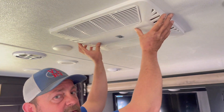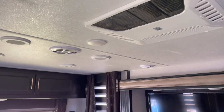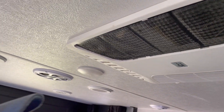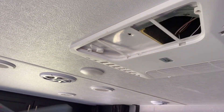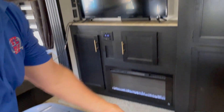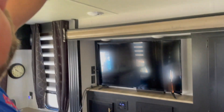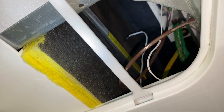If you've got a camper or motor home with ceiling assemblies where you can access the air conditioner, you're going to want to pull the grate off — on these Colemans, I take a little pocket knife so I can get at the end of the filter, slide it out, and check it. If the filter's clean, great. If not, clean it up and let it get good and dry before you put it back. Right up here in the air return is your evaporator. When checking your air conditioners, make sure the freeze sensor is seated nice into the evaporator so that you don't have an ice-over event.